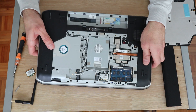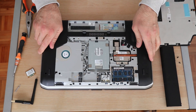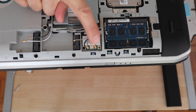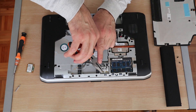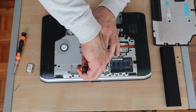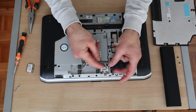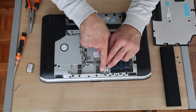As you can see, the wireless LAN card is right here — that's the one I'm going to change. To do this, it has two small connectors that you should carefully remove using a set of pliers. Very carefully — don't squeeze on them, just pull them gently. Polarity is very important, so make sure the colors connect to the new card the same way: this one is black, and this one is white.